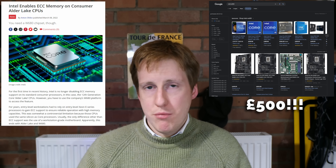The next thing to decide was which team to bat for — Intel or AMD? I've never built an AMD machine before, but that changes now. I've always liked Intel machines but by now it's pretty clear they're not front runners, certainly when it comes to efficiency, power draw, and even raw performance. Within my constraints, I wanted ECC memory and a GPU. You can do that with 12th and 13th gen Intel, but you'd need a W680 motherboard — prices for those typically start at around £400 to £500 in the UK. That blows my budget before I've even started, which pretty much ruled out Intel in one fell swoop.